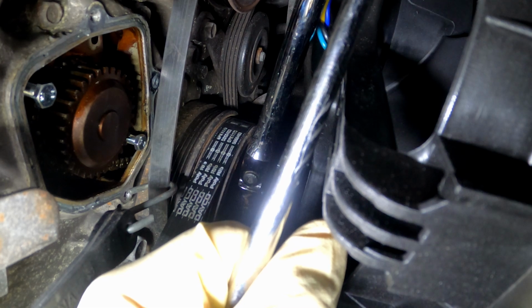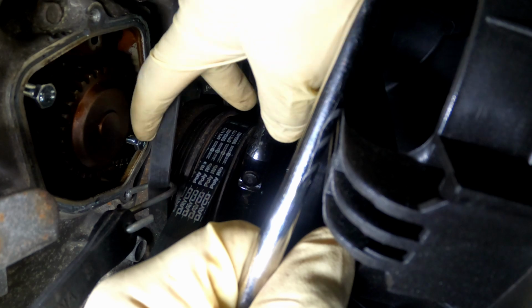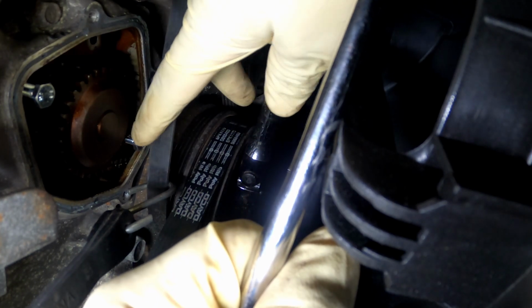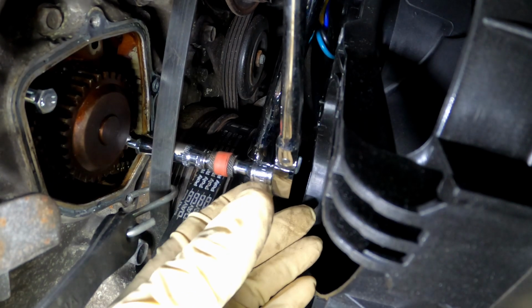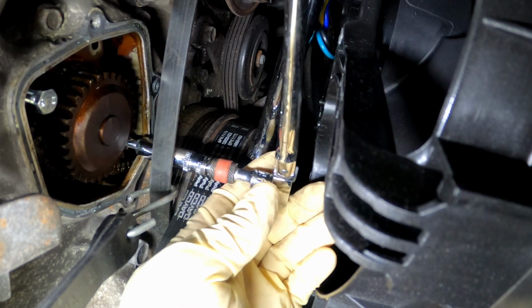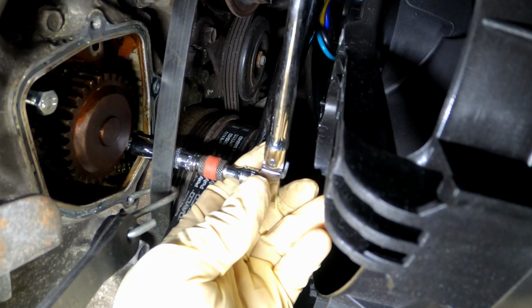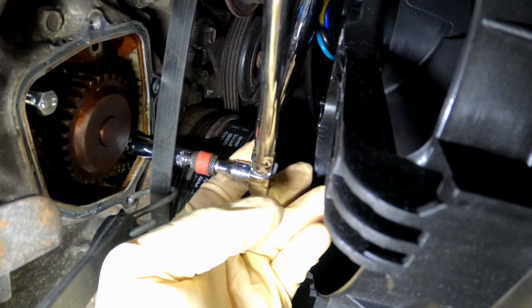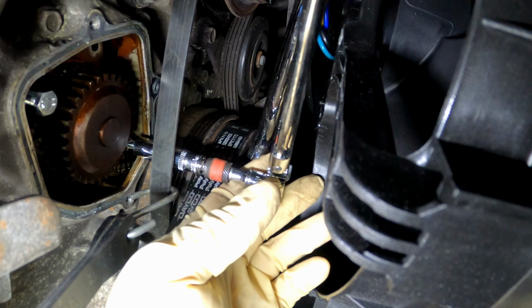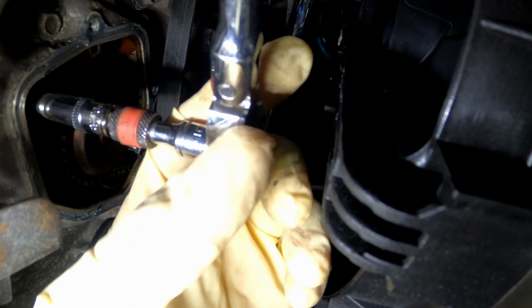All right, y'all, so once y'all ready to press out your water pump with your 2 bolts, this one and that one that you're going to use, you're going to get on your bolts and you want to press them out, screw them in evenly. So you want to just take your time. It's going to feel tight, but just screw a little bit and go up to your top bolt here. It's 3 holes, but you only need 2 bolts. Use 2 holes. A little bit up top.